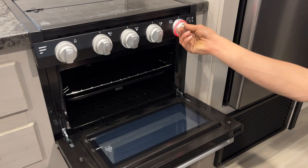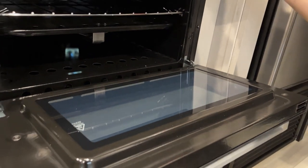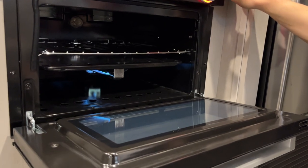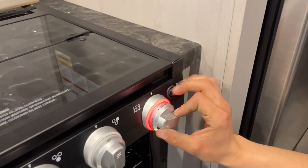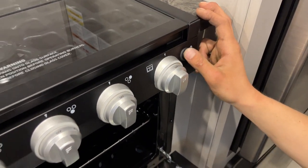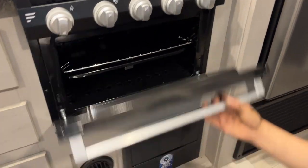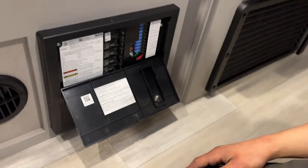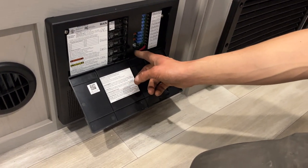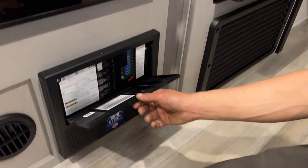For the oven, flip it open, grab that knob, turn it over to the little flame, hit the igniter, and you can see the pilot light gets going. Once you have it going, hold the knob for another second, then release and the flame will hold itself. Turn up to your desired temperature and it flies right up. Once you're done, turn it back down to pilot and it'll hold just a pilot light, but if you're going traveling, make sure it's right off. Switch one is for your knobs, switch two does the knobs as well as the oven. Underneath all that is your converter — press the top and center and it'll pop open. All your breakers are in the middle; whenever a breaker trips, it sits in the center, so just turn it off and back on to reset it. All your fuses are on the right side — whenever a fuse pops, there's a little red LED right beside it letting you know exactly which one went.